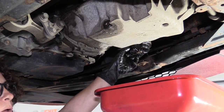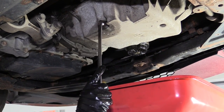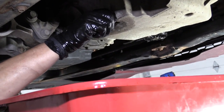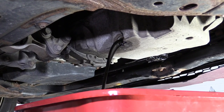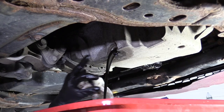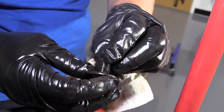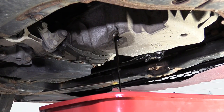Now that my oil is drained out of my oil filter housing, I'm going to move on to the drain plug. This is a 13 millimeter wrench or socket — I'm going to break it free and then drain it into my catch pan. If you noticed, that drain plug came out pretty smooth. I turned it out the rest of the way with my fingers. So that tells me that the oil pan is in good shape, threads are fine, and so is the drain plug. I always give the drain plug a quick visual — see that there's no threads that are crossed, no debris. This particular drain plug, the gasket is built in, so there's no need to replace it at this point. It looks nice and good, it's not torn, so I can reuse this. I like to let the oil drain out for a good 10 to 15 minutes.